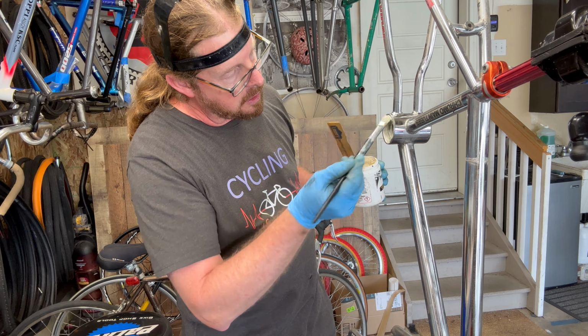Same concept here as the headset. Put the bearings in. Okay, the cages. So big ball bearings, big balls showing out. Go on the inside. Same thing for the inside compression. Big balls in. And because the race, let me show you. The race, it would look like it worked this way, but that race is going to go right up against that cup. So that bearing race fits on the inside of the balls on the outside of the bearing cage, and that's where you get that fluid motion. So big balls in.